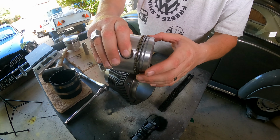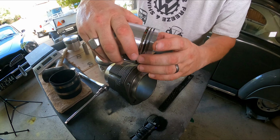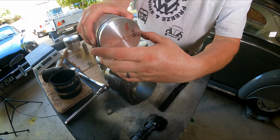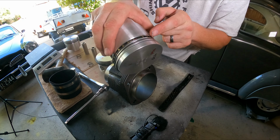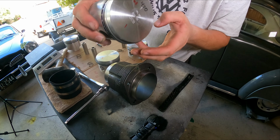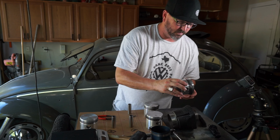You got to line up these piston rings. See how they got the gaps? You don't want those to be the same, and you definitely don't want those to be at the top. So I put them one on each end, just like that. The oil ring, I think, doesn't really matter because it's pretty much the same all the way around. This has a bunch of holes in it, and it flings oil. But I put the little red and green mark at the top. You know, this is all going to move a little bit, but you don't want it to move a lot of it.